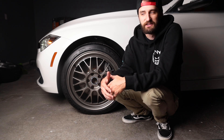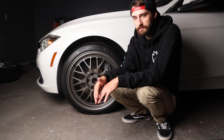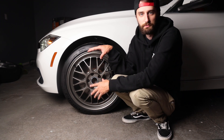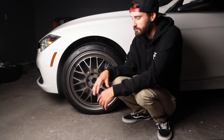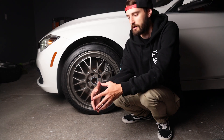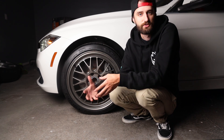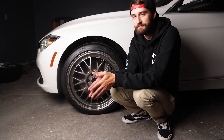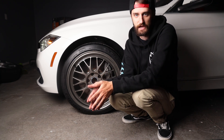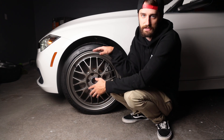There is one small caveat. As of September 2020, they don't currently make this wheel in BMW sizes yet — this is like a one-off set for my car. What they're trying to do with this build isn't necessarily to just sell a bunch of wheels; it's more to gauge interest from the BMW community before committing to a full-scale production run. They do sell this in the 5x120 bolt pattern, but the center bore is going to be too small straight out of the box, so it won't fit onto the hub without some customization. If you want to see these wheels in BMW sizes, leave a comment, message them on Instagram, or email them directly. Another option — if you have to have these wheels today — is to have the center bore enlarged. Any machine shop or wheel repair shop can do that easily and it's not expensive.